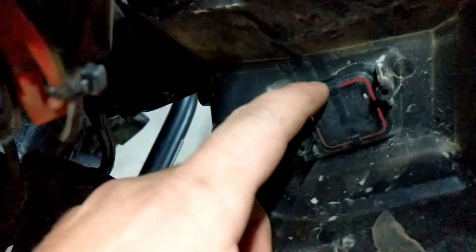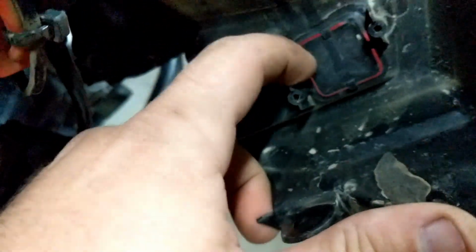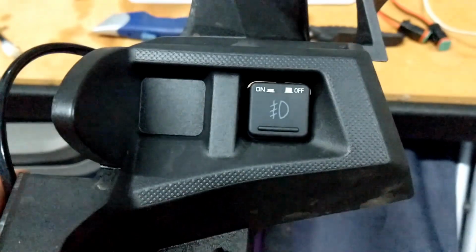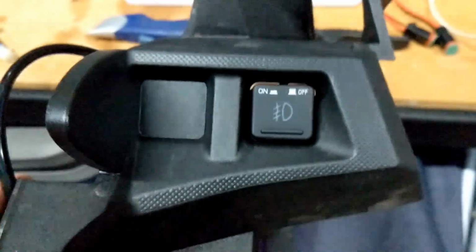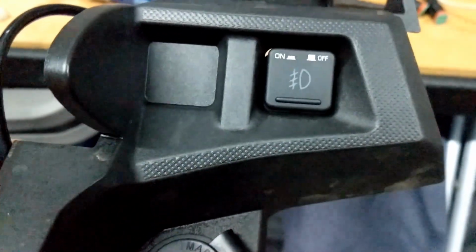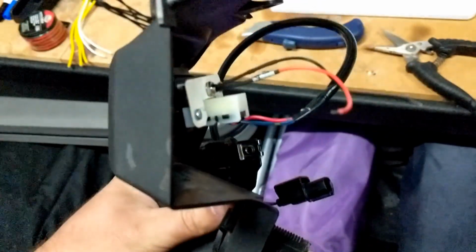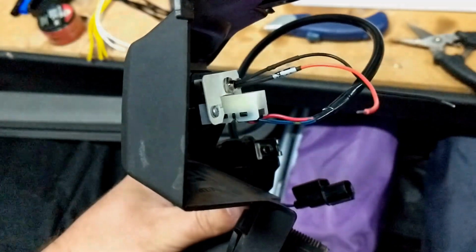So I've got this side piece off here. This is the back of where the switch goes through, so you've got to cut these little tabs off so that the blank comes out. So there's the switch mounted, really easy, just cut the blank out with a Stanley knife. Two screws which are supplied with the part in the back. And I've got my little LED piece in there as well, so now just to make the loom for the rest of it.